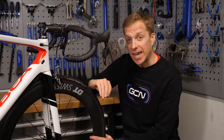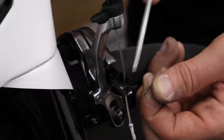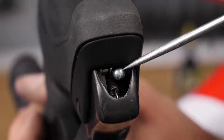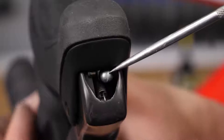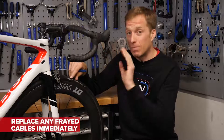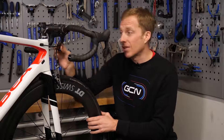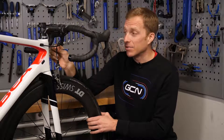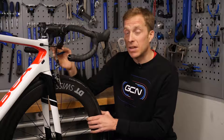Now a quick check of the inner cable. Make sure where it's clamped that it's not frayed or strained at all. If possible, have a look inside the lever and make sure there are no loose strands of wire where the barrel is. If there are, don't ride the bike — replace that cable as soon as possible. Also check that the outer cable's protective casing is not split and there's no corrosion. If there is, replace that too.